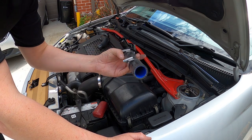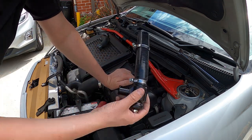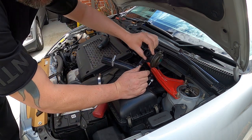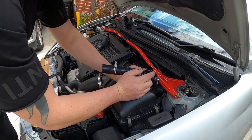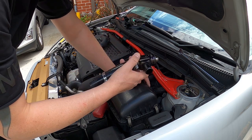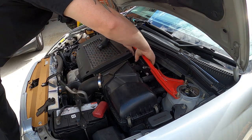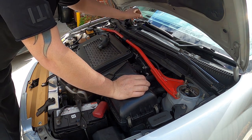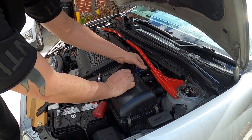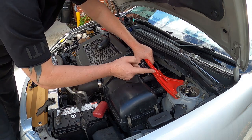I've used a piece of silicone radiator hose that I had lying around and a couple of hose clamps. I'll just slide that on and clamp it down. This size isn't quite the right size for a Caldina — the inlet and outlet are actually 29mm, whereas the TurboSmart blow-off valve that Truong's got is 25mm. I believe you can get bigger ones, so just make sure you get the right size. For the plumb-back situation, which is what Truong wants, we just need to get another piece of hose to join from here to here. On the top of the blow-off valve you'll see the vacuum line nipple — you just need to remember to connect that up and everything will work perfectly.